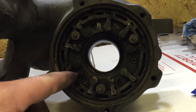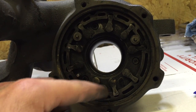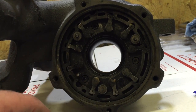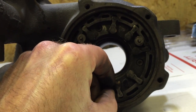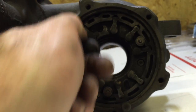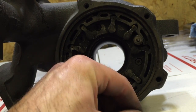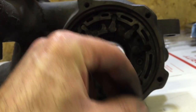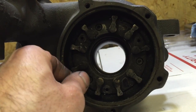And then you're done. Here's the VGT system. Keep in mind there's a peg here — there are three of these rollers and pegs, and these connect to the bearing housing. Don't be afraid to take this apart to clean it. The pegs come out — keep in mind the orientation. You can pull these pegs out like that and then the rollers will come out, and then this peg comes out.